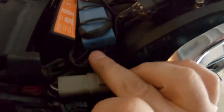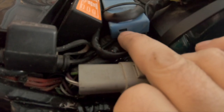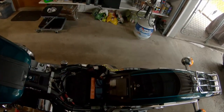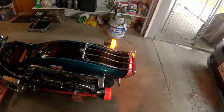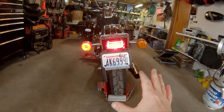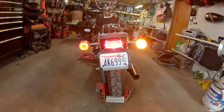She's wrapped up and everything works. I did have a slight issue: hit the blinkers, they'd flash a couple of times, pause on, then flash again. I thought it was a synchronization issue, but it's not. On this load equalizer there's a switch — one side is regular or normal, the other side is high — it has to do with resistance. As soon as I switched it to high, it took care of that issue.